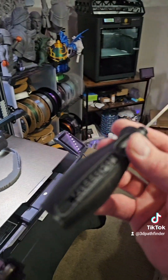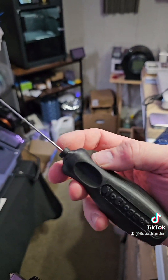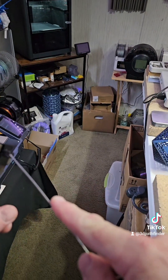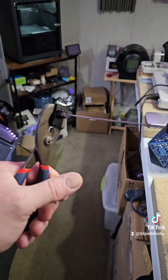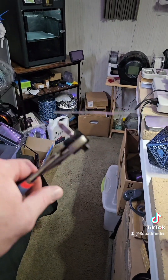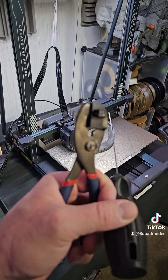But the no-clogger is great. You can get it on Amazon. It's really inexpensive. This is just a 3D printed handle, and then it's a rod that's the exact size — 1.75 millimeters — and it fits all the way in there good and snug to where it pushes all the filament out and you'll clear a clog. So there you go, just wanted to show that.